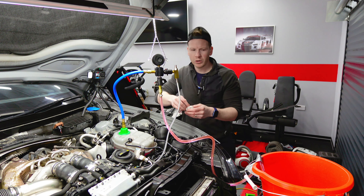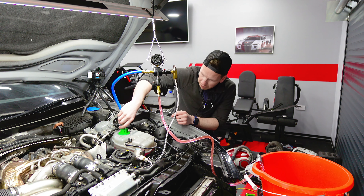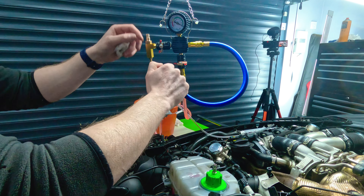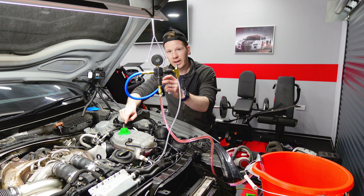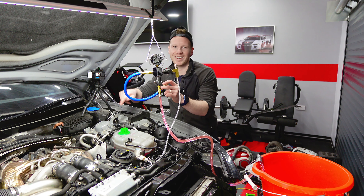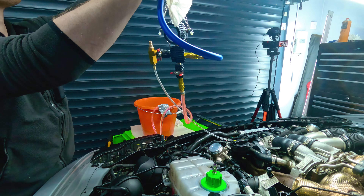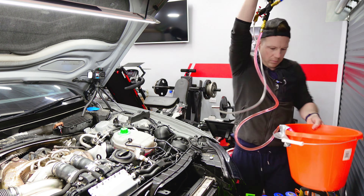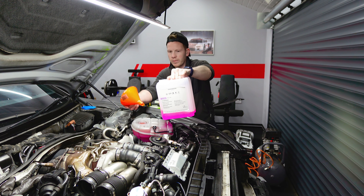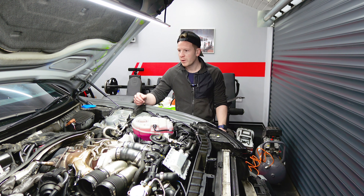She's still sucking. That's pretty much at zero now. It's stopped audibly pulling through the coolant, so I'm going to turn this off and disconnect this pipe. The coolant reservoir is pretty much halfway full now, so I'll disconnect this pipe, take this nipple off and fill up the coolant reservoir to the max.